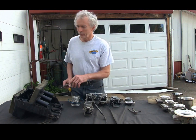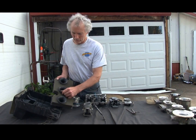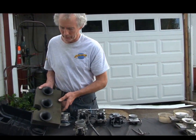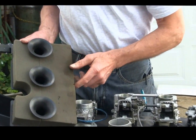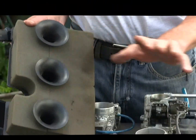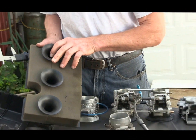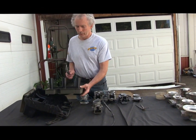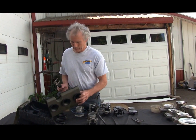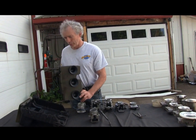This is actually off of CK3. If you look at the air horn — ram tube, velocity stack, whatever you want to call it — this is only 28.3 millimeters, three of them. The stock sled has three carbs, 38 millimeters, so your first thought is, how does it work? Well, if you come to this end, we're down to almost 40 millimeters — 39.9.